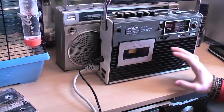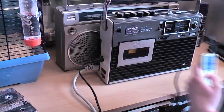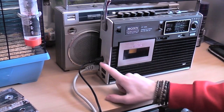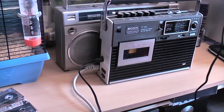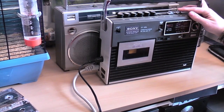But that really doesn't matter. If you want this retro look and retro sound you're going to be in heaven listening to mono. Now what I recommend doing on your iPod is turning mono on — because most tracks these days are stereo and some instruments are panned right and panned left. On a system like this, depending on how the DIN connection works, some of them may only accept one channel through the speaker. A good test would be to find a hard panned song and see if you can hear everything. Setting your iPod to mono is still a brilliant idea. Okay, we're going to play a song and we're going to turn the iPod up — let's whack it up all the way — and let's turn the volume of the stereo up.